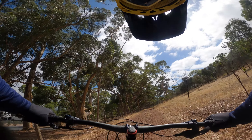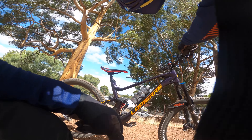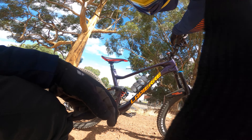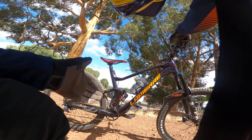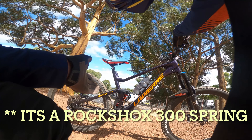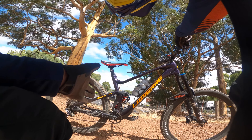Overall not bad really, definitely better. I had a little slap on this with the alloy frame just mainly around home and on the creek, and the alloy frame just felt a little clunky and didn't feel that crash hot - felt a bit rough. This feels better. The frame feels good. The rear shock's just a little choppy still, maybe it's the spring rate. That's only a 300 Fox spring and I'm quite low in the sag. Maybe bring it up a little higher. For his weight - he's a little bit lighter than me - probably pretty good. 150 dropper.